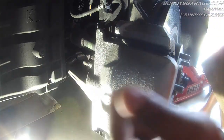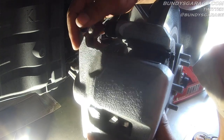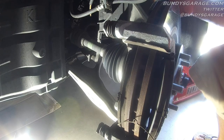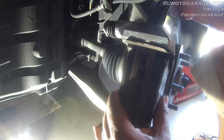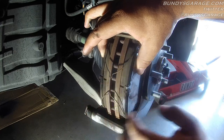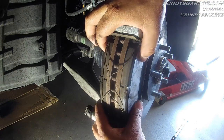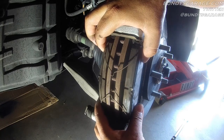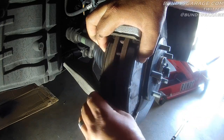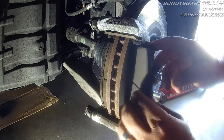I took the brake caliper off and right here is the brake pad — here is the other brake pad. Outer one, inner one. Right here you have these brake pad pins. These pins actually push out on the brake pads so you don't get that squeaking, binding noise that you sometimes experience — very neat design. You just pull this pin off straight up and out. The pins are exactly the same. Pull that one out, it relieves the tension, then you pull the brake pad straight out towards you.